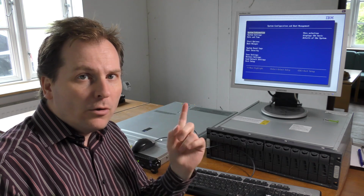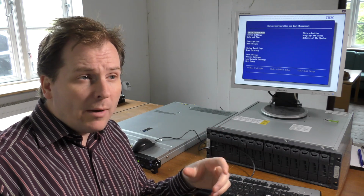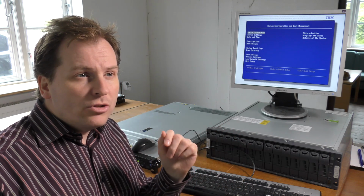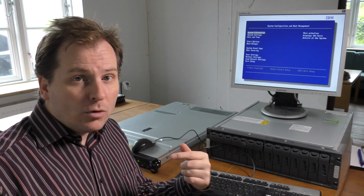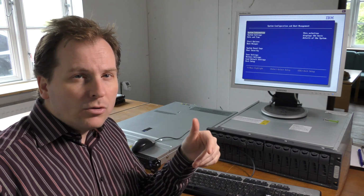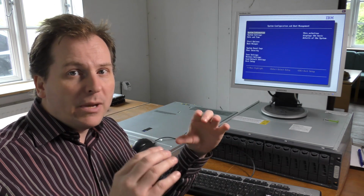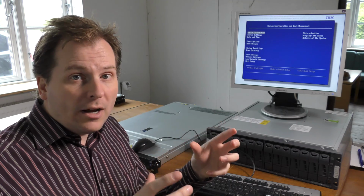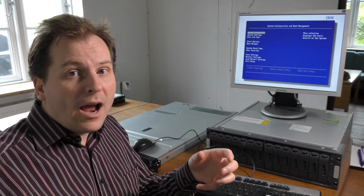And I've just been on Lenovo's homepage and found the BOMC, which is a piece of software that does exactly that. It's kind of a Windows program or a Linux program that you download. You tell it which server versions you have. You can give it multiple server versions, and it will see all those server versions, and it will download all the firmware updates for those servers, and they will make a nice little bootable ISO file. At least that's one of the options there. Bootable ISO file that you can then boot on, and you can upgrade all of the server's firmware that way.